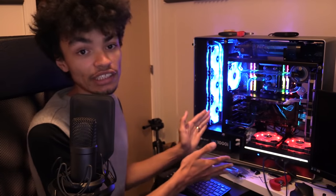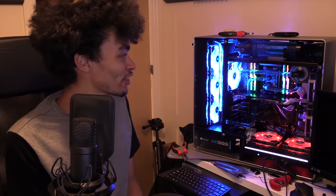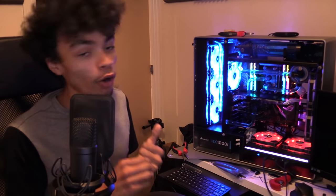But I got acrylic, then I did some research and found that PETG is the best way to go. So this system now has PETG in it, which was a lot easier to work with, so much easier. This was also my first time drilling the case, and it was actually kind of fun. At points, I did not take the motherboard out, and I was kind of wary when I did that, but for the most part, I just took the motherboard out for the big drilling.